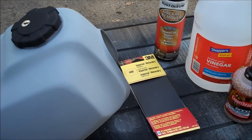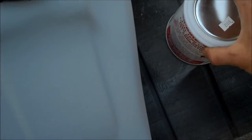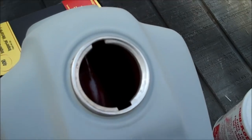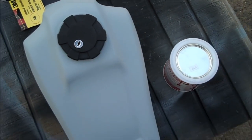To get the paint off the tank, I used Rust-Oleum Aircraft Stripper — it makes that job pretty easy. And finally, once I got all the rust out, I used Red Coat Fuel Tank Liner. I'll never have to worry about rust in my tank again, and it's safe to use ethanol in it as well if I have to.